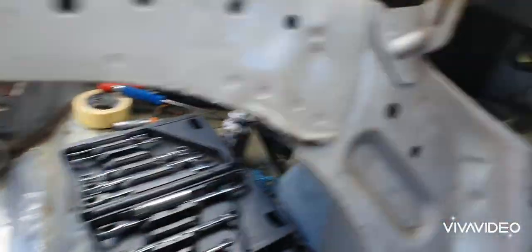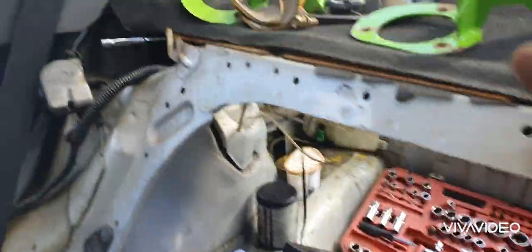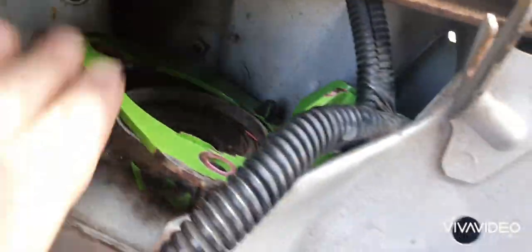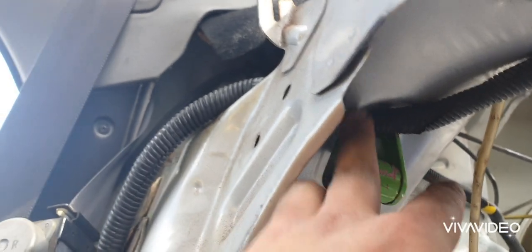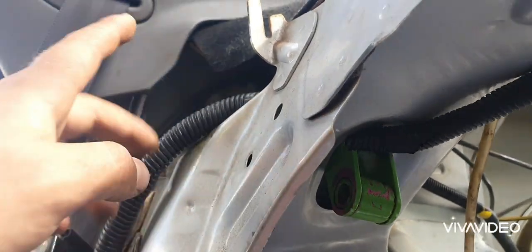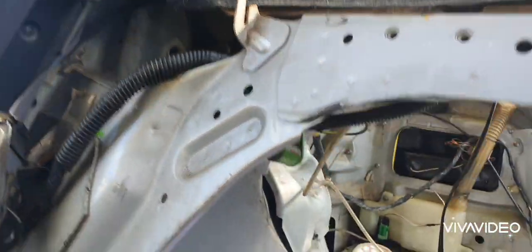We're on the last bolt for this side, then we'll move on to the other side. I really don't think these things fit at all. That's kind of in place, but it can't sit flush with the strut tops because there's zero room — if you force it up any further it's going to damage the wiring, and even with the wiring removed, there'd be zero clearance through the hole. I'm not sure if you're supposed to cut some metal out or not. I think in the meantime I'm going to abandon this for now and look into the matter, because I've tried both brackets on both sides and there's just no clearance at all. Something isn't right. We're going to abandon this and look into it, because that's just not right at all.